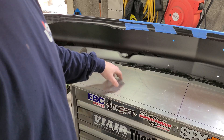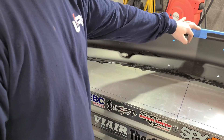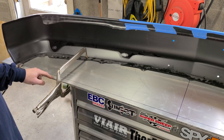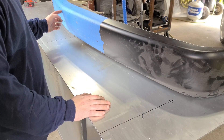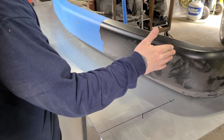After that odyssey of trying to straighten this bumper out, I got to lay down on this piece of plate, marked the center line on the plate, and lined up the beak of the bumper to that center line. On either side I took a couple of bolt holes, made a one inch line all the way across the back of the square edge, got it all lined up. That's what the front side looks like. Got the center line marked on the beak of the bumper, here's the center line of the plate.